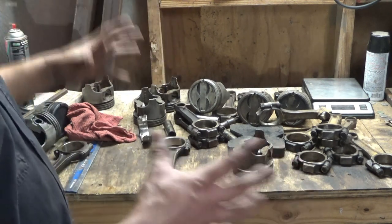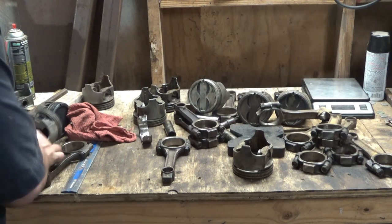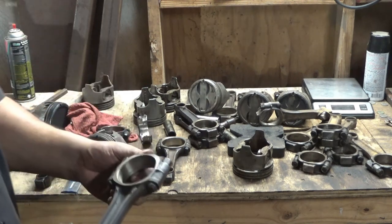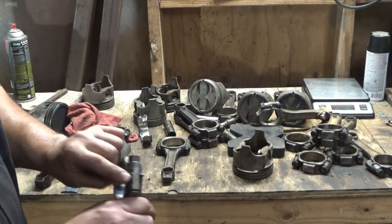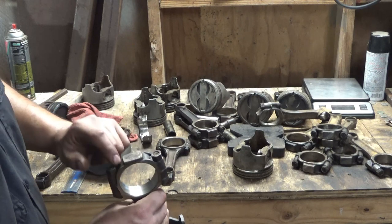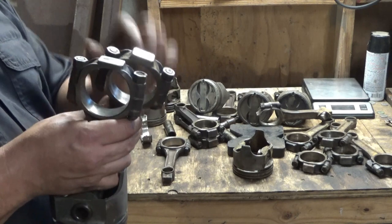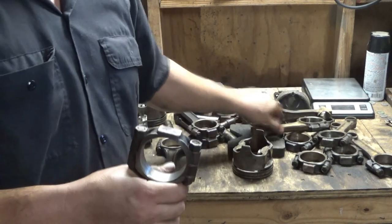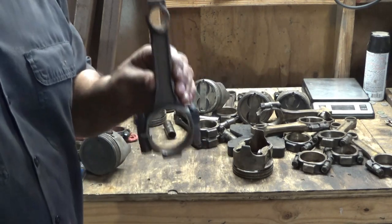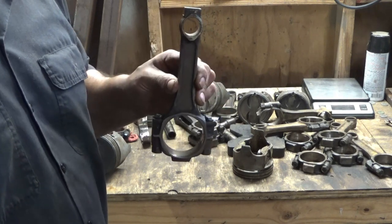The rods — I'll throw them in a box and decide later what I want to do with them; they'll probably get scrapped too. But I have all these other pistons, especially this one that happens to be stamped number eight out of a different engine, and the rods look exactly the same — they have little X's on them. The goal is to find another rod that weighs exactly the same and appears to be the closest thing possible to replace it with. That's the whole purpose of pressing all these pistons off.